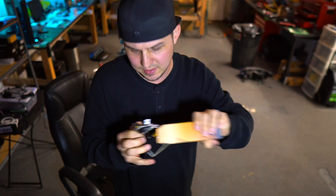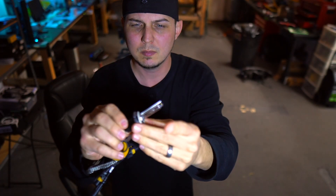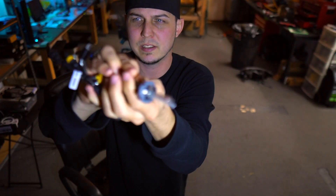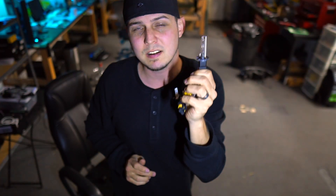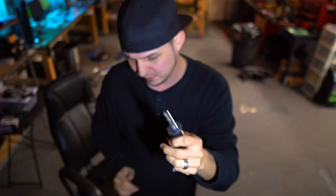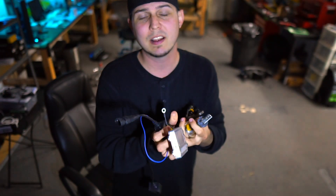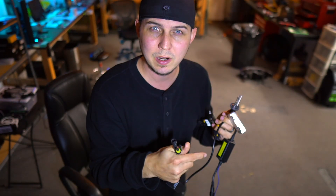Side note: if you don't want to use a factory ballast and you want a D2S style bulb, there's a bulb called the D2H. It looks just like a D2S bulb, except it has regular amp-style connections on the back. You could have used something like this on those V-Land headlamps without converting to the true OEM ballast with the igniter routing — that was actually a huge pain. This is a much easier alternative, letting you run just a regular amp-style ballast with easy plunger connections at the bottom.